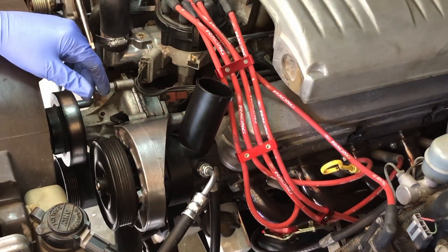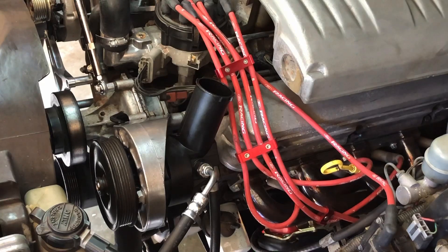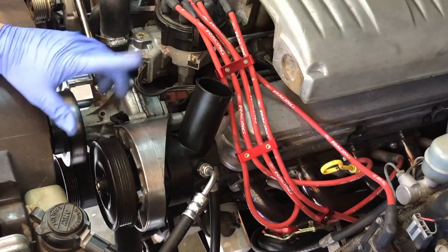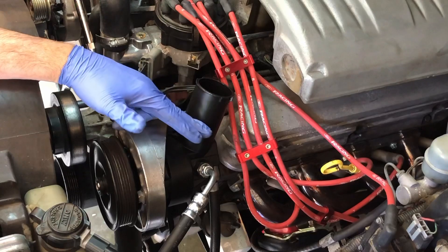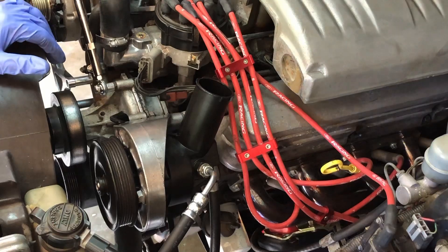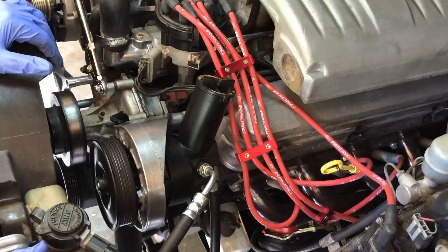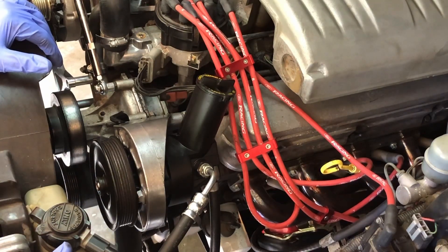Alright, that's it — you're at the end of the video. The power steering pump has been replaced, all three hoses are replaced, and we even removed the power steering cooling tube and cleaned that. The only other thing left to do is start the car with the belt on, monitor the fluid, and fill it as needed with the car running — and then you're golden. You definitely want to check for leaks once you've run the car — jump underneath and check for leaks anywhere to make sure all the fittings are sealed properly. Thanks for watching — please leave some comments. I want to see things you've done differently or issues you've run into. Also like and subscribe, and we'll see you next time.